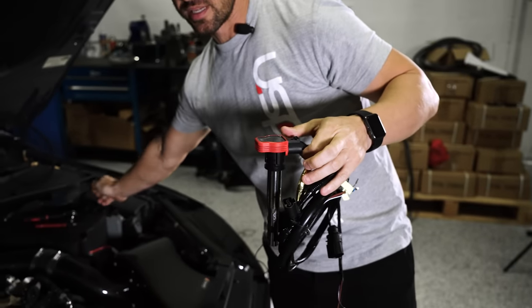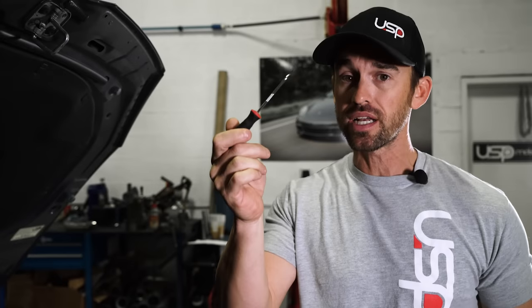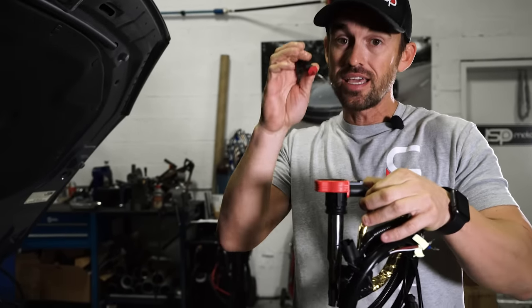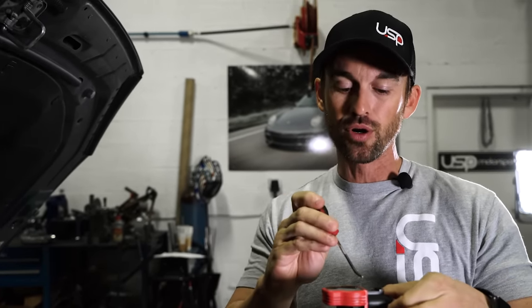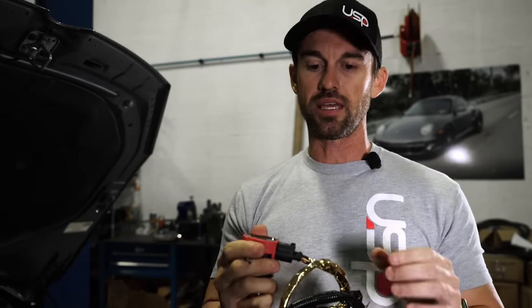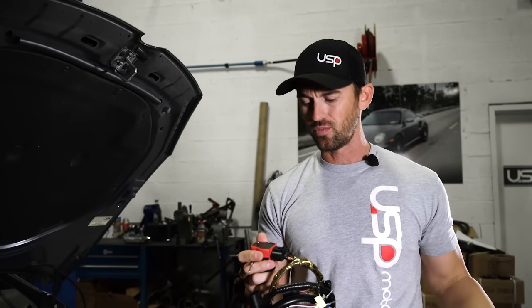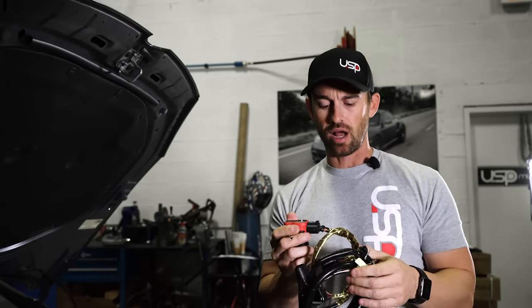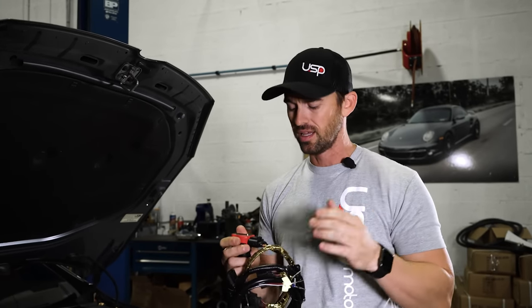The biggest misconception about these connectors is you walk up to one and try to undo the clasp and you will see it doesn't work — this clasp doesn't come out. I went to YouTube the other day and typed in D connector or electrical terminal for your European car, and I was ashamed of what I saw. Guys were recommending using pick tools, screwdrivers, getting in there and prying it. If you are using a pick tool — big do not. You're going to damage it. Yes you might get it off, but the next person who works on the car is going to be upset. Not only that, if you have a damaged coil pack connector you're going to have misfires — it can leave the car running on three or five cylinders. I've seen these clips broken on engine temp sensors and cars doing all kinds of weird stuff.